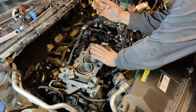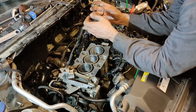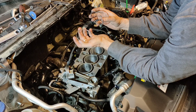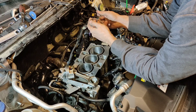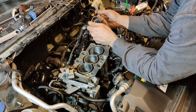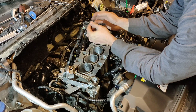I've already done cylinders one and two, so I need to do number three over here. We have the first ring, the second ring, and the oil return ring. On the calculator you can choose your application — this is a forced induction car with a 75 millimeter bore, or about 2.95 inches.